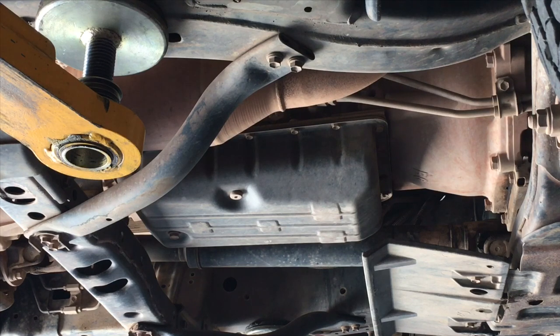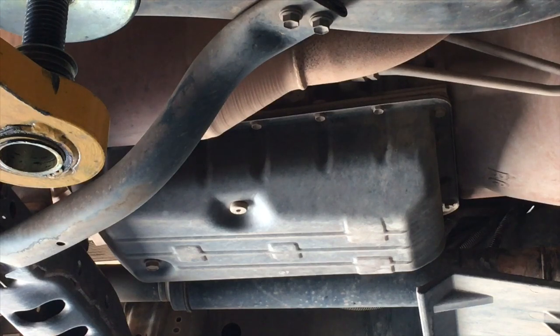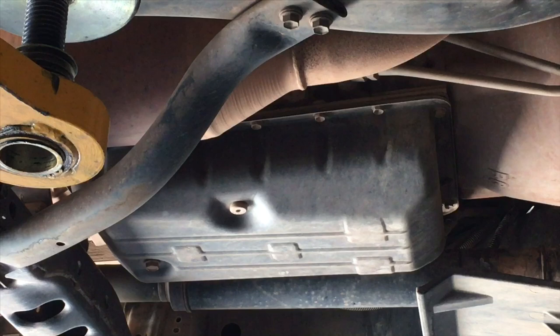The first thing we're going to do is crack all three plugs loose. The filler plug is 24mm, accessed up behind this cross member where the exhaust is. It's ideal if the exhaust isn't too hot, but you do want to have your transmission at around the 40-degree mark. We'll just take that plug right out — it is quite a difficult spot up there to see.